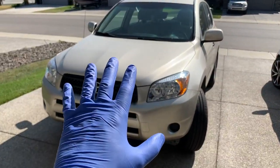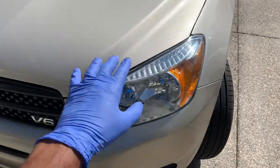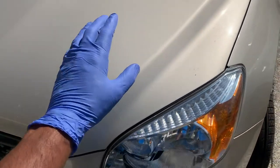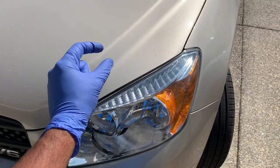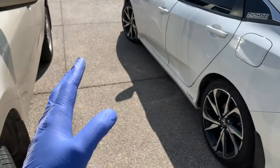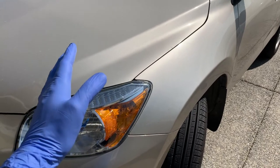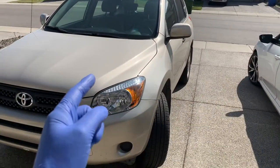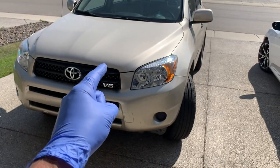Tip number six: always wash your vehicle in cooler temperatures. It is incredibly bright outside right now, and the paint and body is incredibly hot to the touch. As soon as you put water on it, you won't be able to manage the water properly — it'll start to evaporate and leave water stains or water marks on the paint. This may not be as noticeable on a white vehicle, but it's still going to be there. On dark or black paint it'd be incredibly hard to manage. The best time to wash your vehicle is early morning, late afternoon or evening, avoiding direct sunlight.